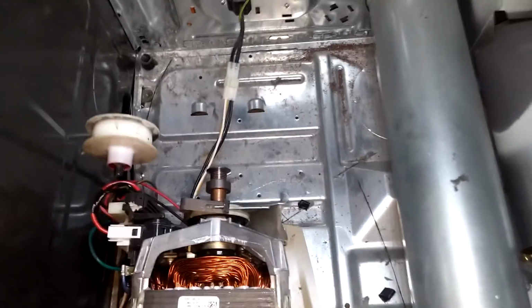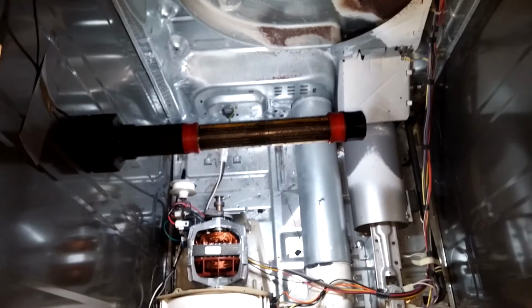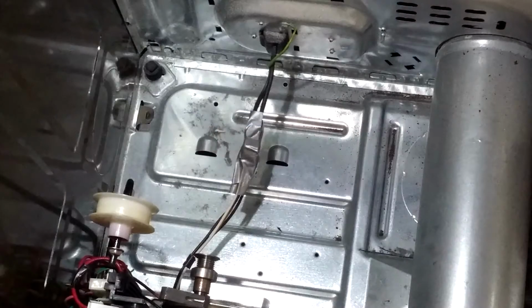When you put the new motor back into the frame, you want to make sure, what I did is I had the connectors pointing up and they have to point to the left side of the motor. I had to tape the front electrical connector with duct tape. It kept coming apart. The locking tab on it's really flimsy.